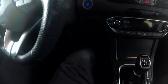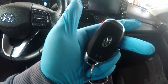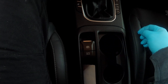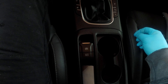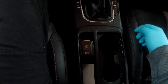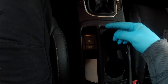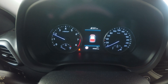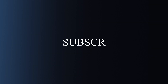Let's go inside. Press the brake pedal a few times to get rid of the gap between the pads and discs. Pull on the handbrake switch — you will hear the motor working for an unusually long time. That is normal as it is adjusting itself to the new pads. Release the handbrake and repeat several times; it should sound normal now. We have managed to do the job successfully and as you can see, there is no warning light on the dashboard. Thanks for watching and see you next time.